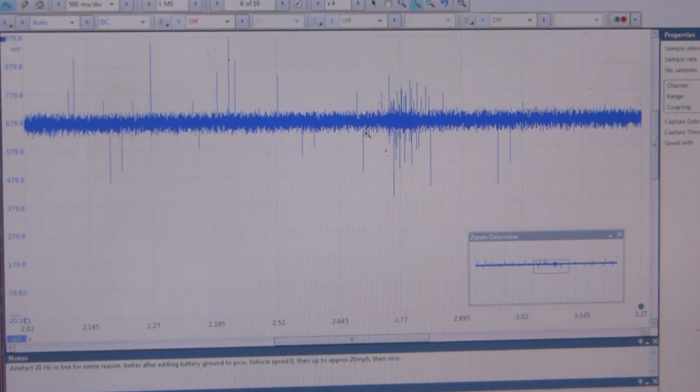Remember, this is a known good sensor. I'm not really sure what I've done wrong here — I rechecked the leads, I tested the bad front sensor, same thing. I'm guessing that GM wanted better slow-speed data than typically seen with their old VRS sensor technology, so the calculations are done within the module by measuring current, not voltage. The fact that the 0.7 volts was present in the front circuit is even more evidence to say that wiring to the transfer case control module is good.